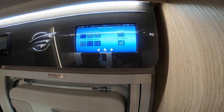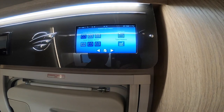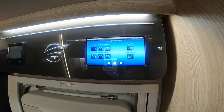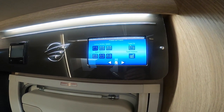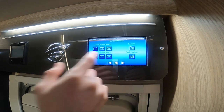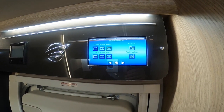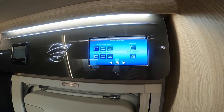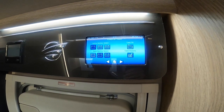the engine battery. The vehicle battery on the solar select is on smart and vehicle, so if it's stood up like it is on the forecourt at the moment, the charge that it gets off the solar panel is going direct to the engine battery. But smart means it analyzes both of them, and does crossover to whichever one needs it.